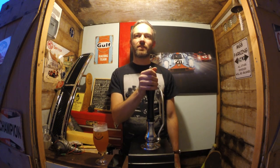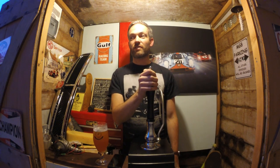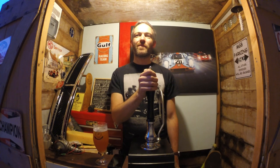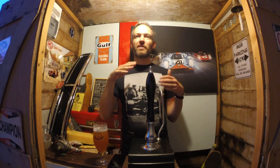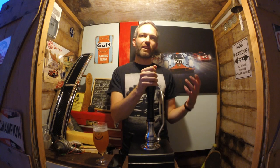That's pretty much it in terms of distributors and electronic ignition. I really highly recommend electronic ignition because the aftermarket condensers are terrible quality and won't last half as long as the old ones. If you've got new old stock condensers, fantastic — go for that. But the new ones I've had can last less than 200 miles, or it's like a lottery — anywhere from 200 miles to a couple of thousand. You don't want that weighing on your mind every time you go out.